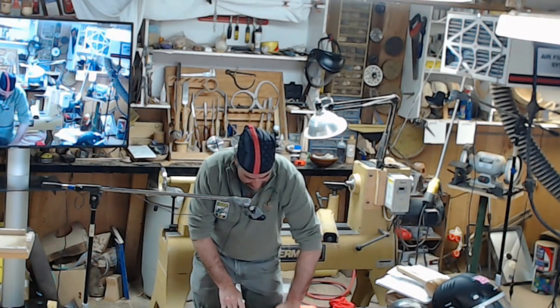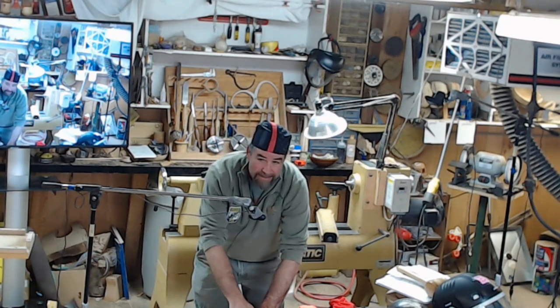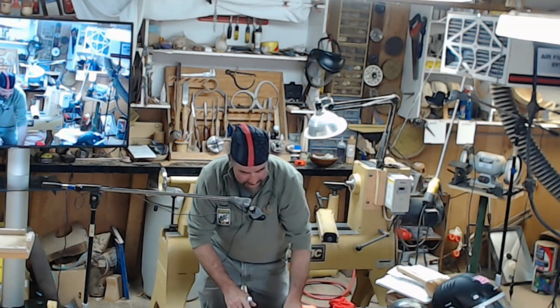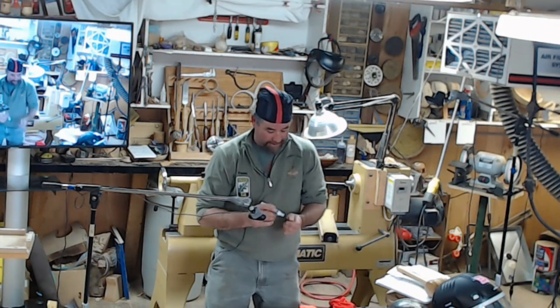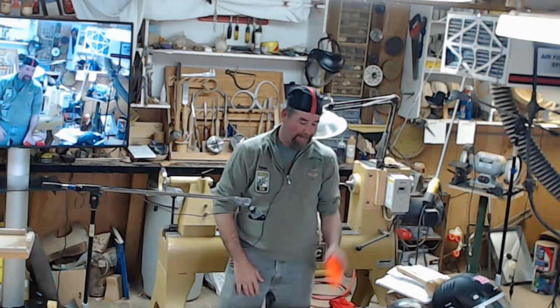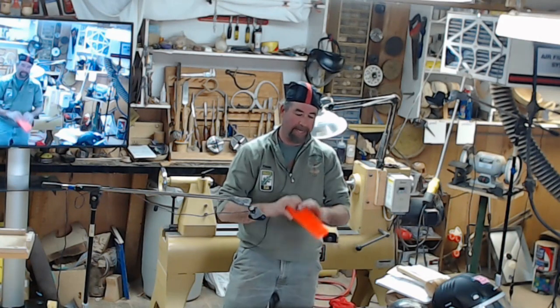Another one I'm going to scare you about is when you start cutting into a tree and realize it's hollow. You have no hinge wood. It's gone. That's when it starts getting scary. At that point, notches and wedges really don't work. If it's that rotten, the wedge is going to just compress the wood fiber and it's not even going to lift the tree.